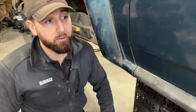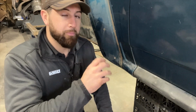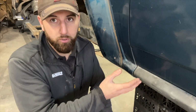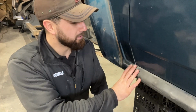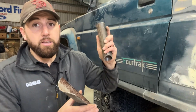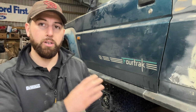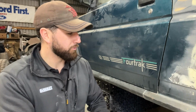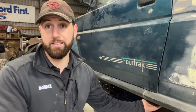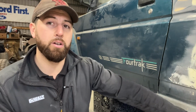And well, the irony is it will look like it's never been touched. It will look like any other Fourtrak sill. The secret is, of course, it's going to be much stronger, and more importantly, it will be future proof. I don't think these sills will ever rust out in the whole time that this truck remains on the road, so it's got to be a good move. So it's not just going to be a tube across where the sill should be. To all intents and purposes, it will look like a standard Daihatsu sill, but it will be much stronger. Once I have run that sill in and I've created a new inner sill as well to join to, that will obviously be connected into the floor of the truck and also into this rear arch I've remade.